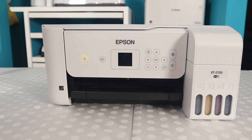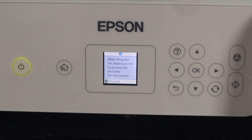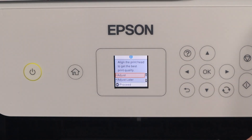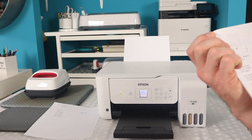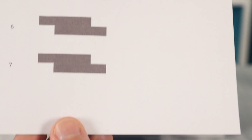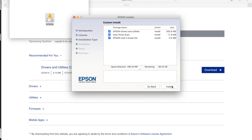Now we're turning on the Epson and doing all the setup — choosing a language and then starting the initialization process. This is where you actually charge the inks. Don't worry if it asks you to fill the ink tanks at this point; it's totally fine that you've already done that. This process will take about 10 minutes. We then run through nozzle cleanings and alignment checks, which print off squares, lines, dashes, and dots — about 20 minutes of this and we have a well-adjusted printer. Some people say to skip this but we wouldn't recommend it. After that we followed the computer setup wizard. We did have to set up the Wi-Fi manually on the printer because we couldn't get it to work from the computer, but it works now.